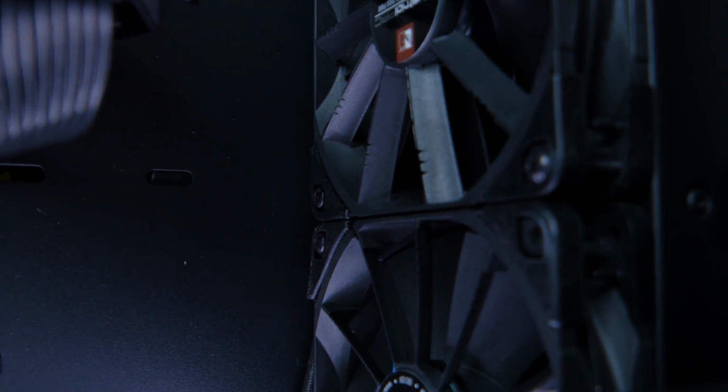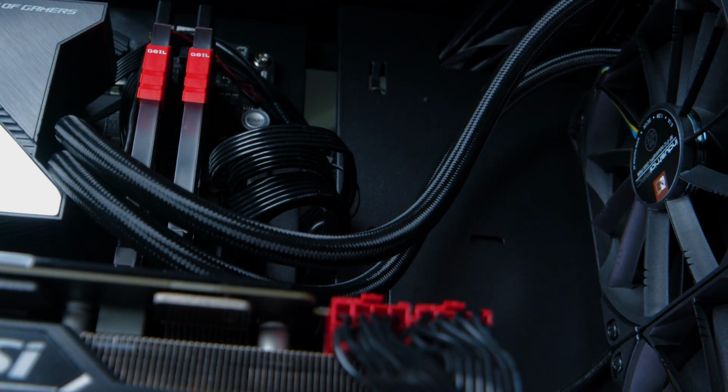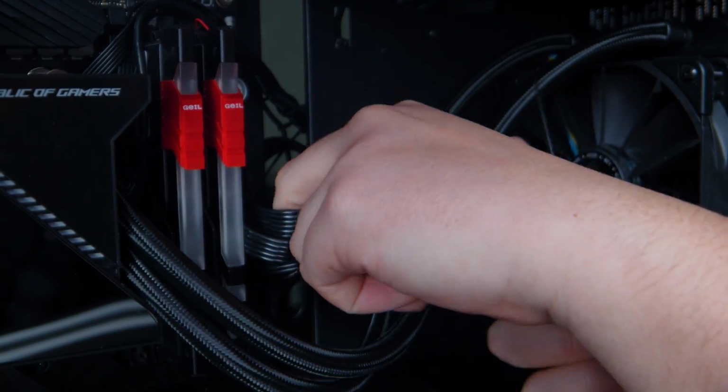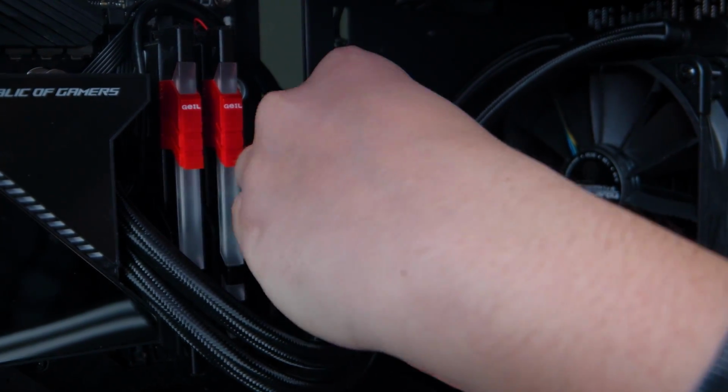You also want to be routing cables in a way that they can be grouped together whenever possible. Three cables running a single route is a lot neater than three cables going their own way. There's a balancing act with this one too, because you need to make sure that each grouping of cables will fit through wherever it is you're feeding it through on the backplate.